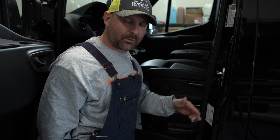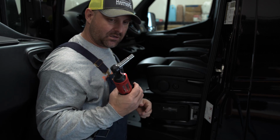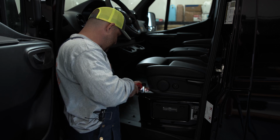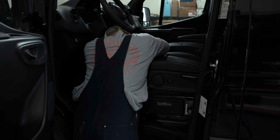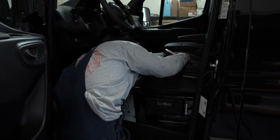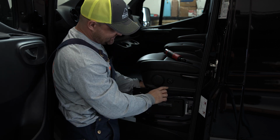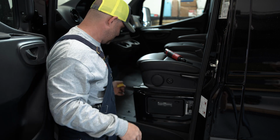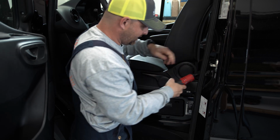We've got a total of 4 bolts holding down the seat. We have the 10 right here. More power, Kenny. And all we're gonna do is go ahead and take those off. Okay. First 2 are removed. There is a little pin set in here for the electric seats. Seat disconnect, check. Go ahead and pull the seat up to the front position, Kenny.